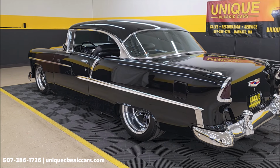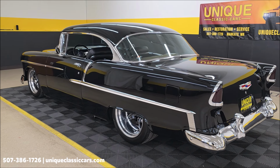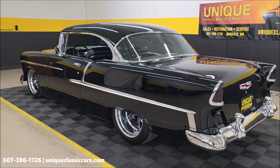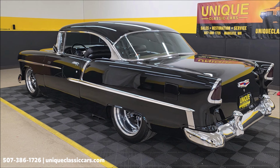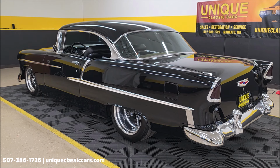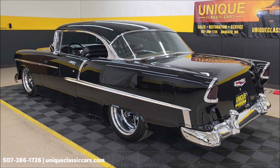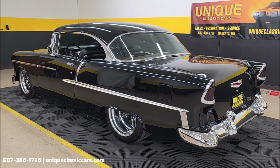We have a lot more to cover. And a sway bar. Brakes: Wilwood master cylinder assembly, hydraulic parking brake line lock valve mounted under the dash, parking brake. Baer 2-piece 13-inch front rotors, Baer 1-piece 12-inch rear rotors, Baer SS4 calipers, all 4 corners, all new stainless lines and hoses.